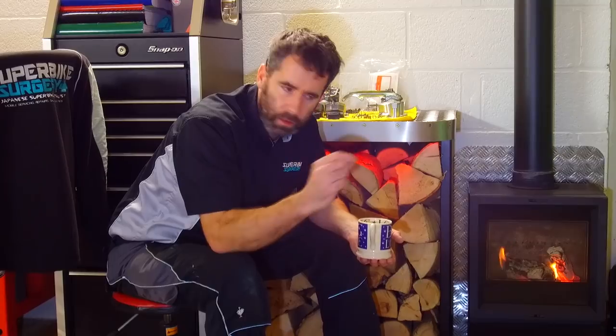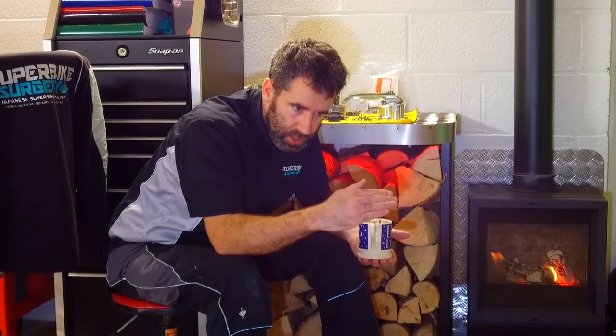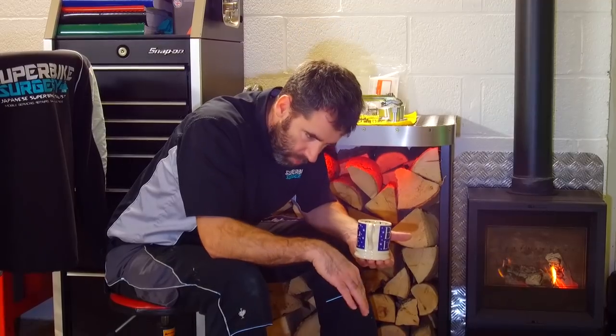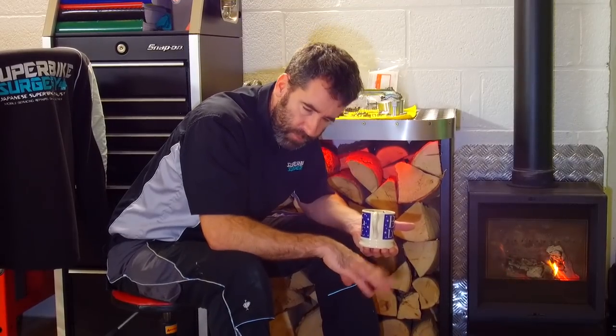I'll do a little bit of theory for you on what that clicking noise is. It's the starter solenoid engaging and disengaging really, really fast, which gives you that sort of buzzing noise. If it's a buzz, then it's definitely a flat battery. Sometimes you get one click and then the clocks go off. When I say clocks, I mean the dashboard just dies. So you push the button, you get one click from under the seat and everything turns off.